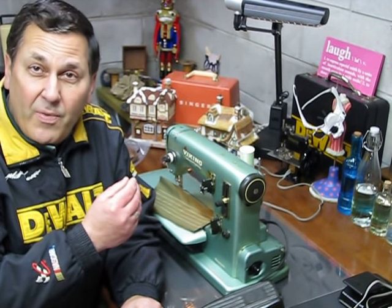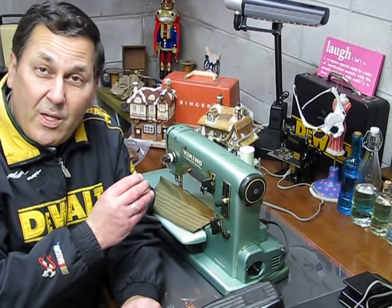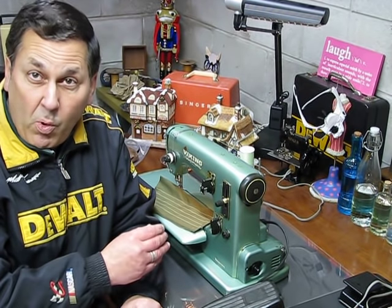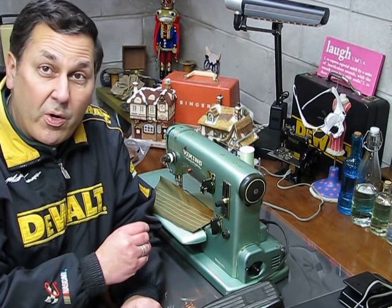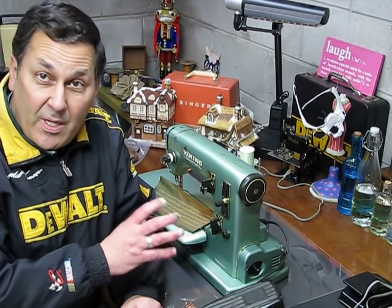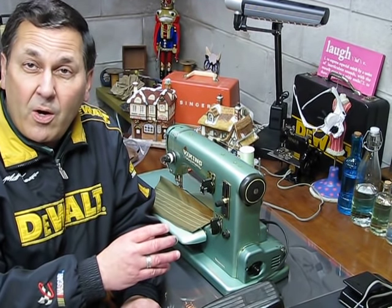So, at any rate, it's really been a lot of fun to get Erin's machine back on track, resolving the tension issues, taking care of the feed dog issue that she had as well, addressing the slow gear, and most importantly, getting the proper foot control with her Type 21, so that when she gets this back in Tucson, Arizona, and if she did a little bit of goofing around on it before and kind of saw the power and performance and maybe the outcome, she's going to be like, wow!